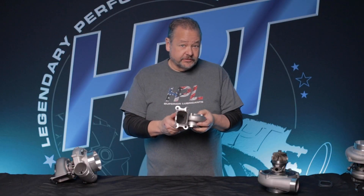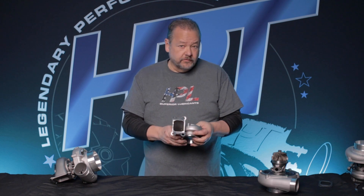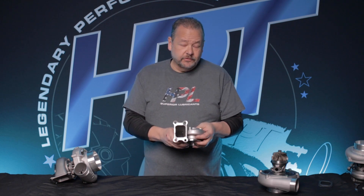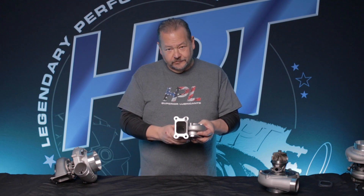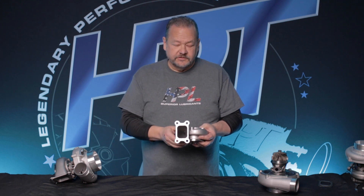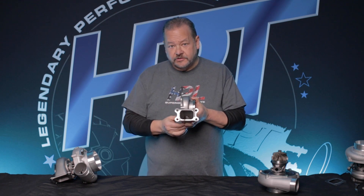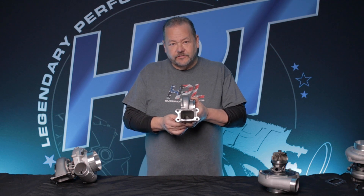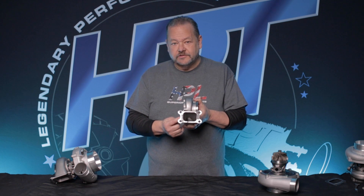This is another big feature of this housing. The T3s have kind of been ignored over the years under the assumption that a round hole is better than a rectangular hole. But when you're trying to put four big primaries into a small hole, this actually has a lot more square area than little tiny round holes. In closing about this T3 housing, look at the square area that you have to build a collector into. For those of you who are already running T3, you may find a significant power increase just with the housing, not to mention all the other features of the turbocharger.